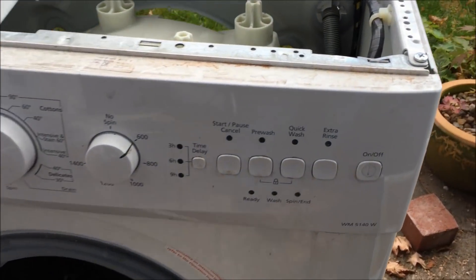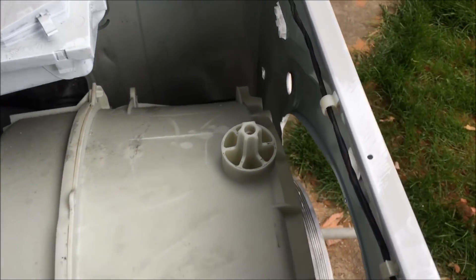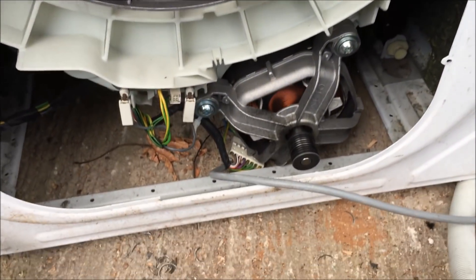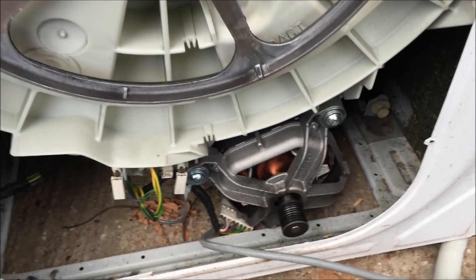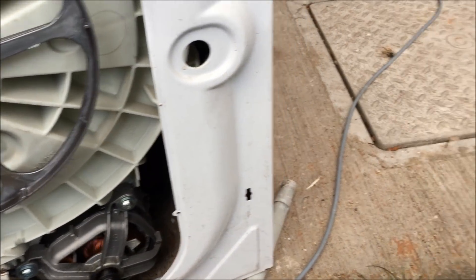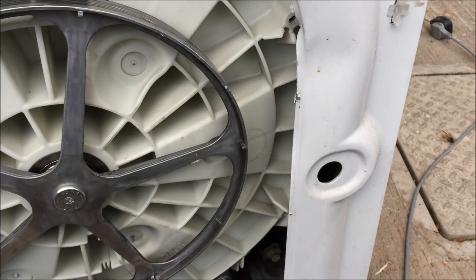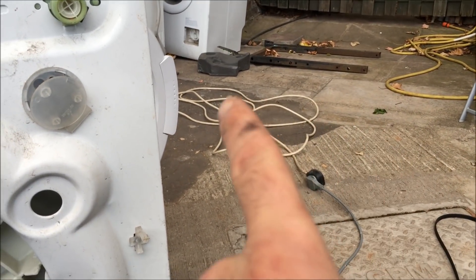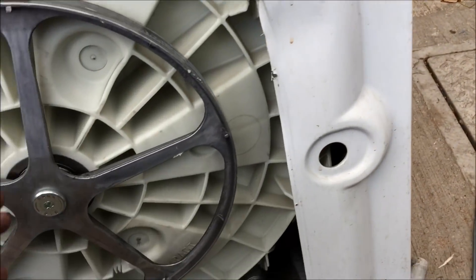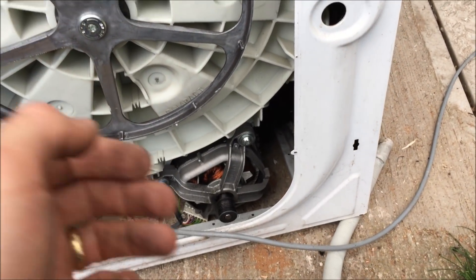So it's a Beko WM5140W, and just as the motor starts spinning down we'll take a look at the damage from that pretty good failure. Motor's just spinning down - didn't even stop during the process, just got such a thunk that something caused a belt to come off. I've righted the washing machine so it's upright again, taken the ballast out and put it over there for safekeeping. It's isolated from the supply - plugged out. Drum still goes around, good sign.